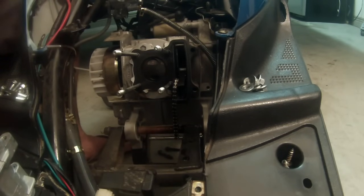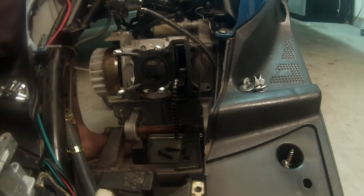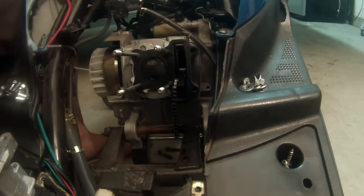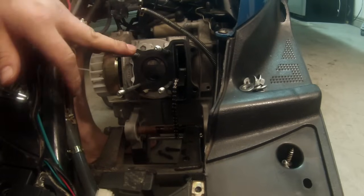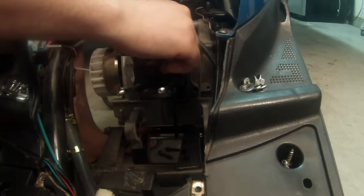And we're ready to remove our cylinder again. I'm at top dead center. I'm going to check our flywheel, and we still are. So this one might need a little love to get out. So I'm going to go grab a rubber mallet. All right, I'm back with my persuader. So I know it's at top dead center, so we're gonna go ahead and give it a couple whacks.